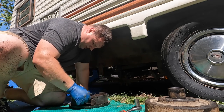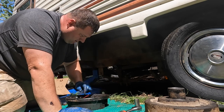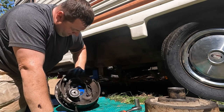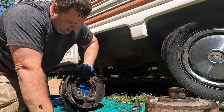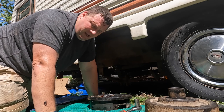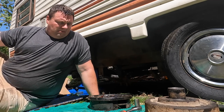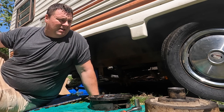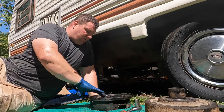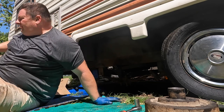Why am I replacing mine? I mean they look okay, they don't look great. One thing is you're supposed to readjust these like every year — there's a little plug in the back and you would pull it out and use a screwdriver or a tool to torque it down. The ones I bought were only about $20 more and they're self-adjusting, so I won't have to mess with that. If you follow my channel, you know I've been having electrical brake issues. I may have already solved it — I found a wiring problem previously with my emergency release pin. But I'm also getting a short when I drive and tow this, and another common reason can be an issue with the wiring to the magnet. So I decided I'm just going to completely replace them.